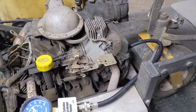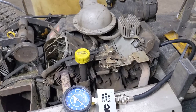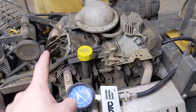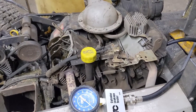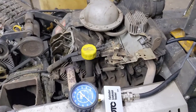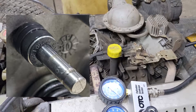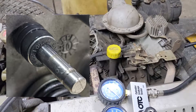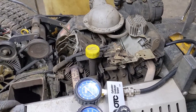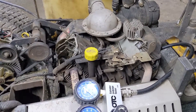The rear cylinder is perfectly fine — no head gasket leak, and the spark plug confirmed that. So I'm fairly certain the head gasket is blown in the front cylinder and it needs to be replaced. While I'm in there, I'm going to replace the valve stem seals as well because they're relatively inexpensive — about $12 — and they just pop onto the top of the valve stem guide to prevent oil inside the cylinder head from leaking down the valve stem into the combustion chamber. I'm going to order a head gasket kit, which runs about $50.